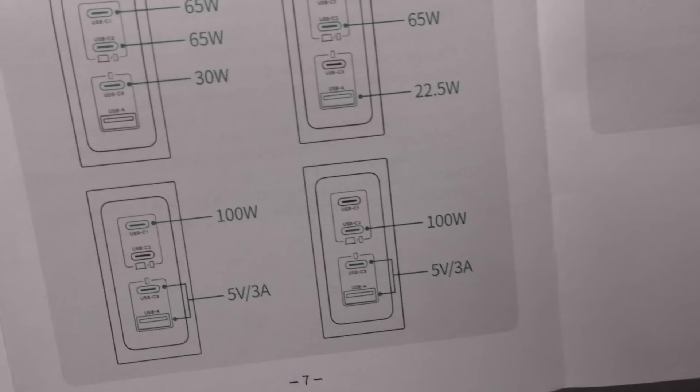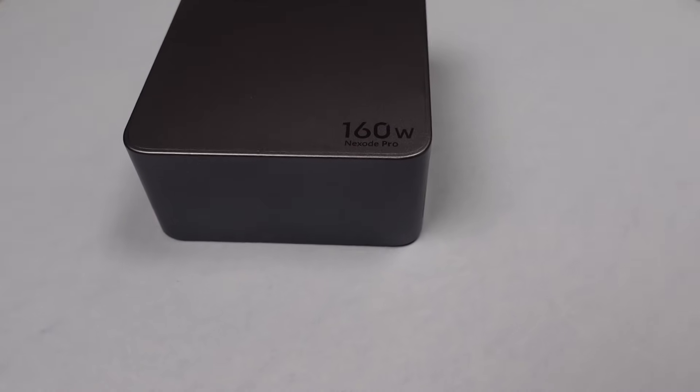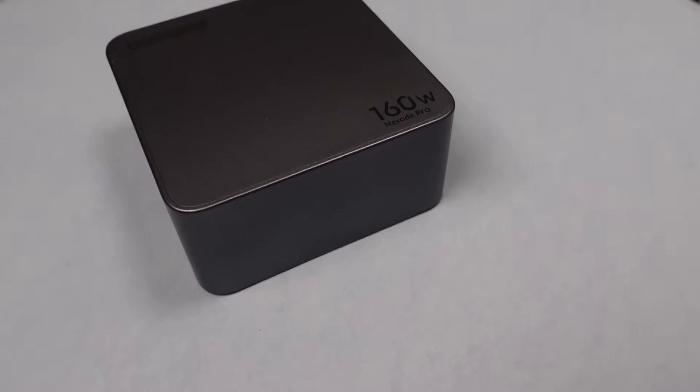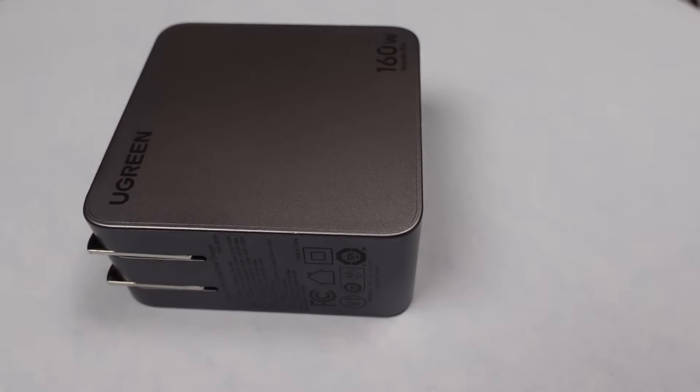The manual gives the usual modes of operation and some basic specifications. I summarized the modes of operation in a table to make it easier to digest. Note that the PPS mode is short of 5 amps, so this could spell trouble for some devices. I used to find that PPS would easily hit 5 amps on most devices, but lately I'm finding the opposite — they fall short on that mode. So this charger will probably struggle to do dual 45W Samsung super fast charging; 25W would be easy, but also a waste.